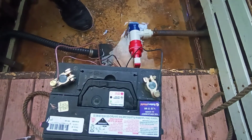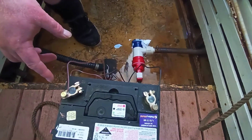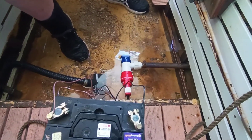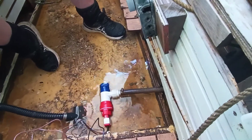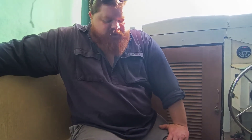The brown-and-white wire is where you'd put in a bilge pump switch so you can start it up manually. Ideally, once this is finished, I've got to put a fuse on the positive side - I believe it's 7.5 amps for this model, but just double check for the one you're putting in. That's essentially it - it's not too hard to do at all, even in these not ideal circumstances. This is a flat bottom boat, which is why I wanted the low pro model - hopefully it'll get as much water out as possible. Thanks for watching, and if you've got any questions drop them below. That's essentially what you've got to do to install a bilge pump.